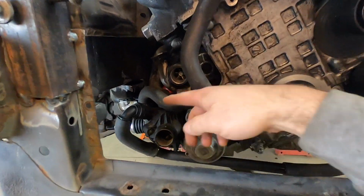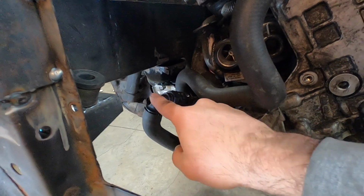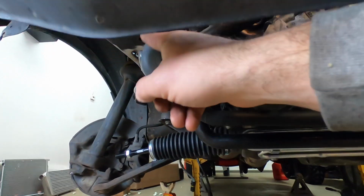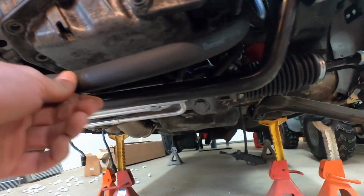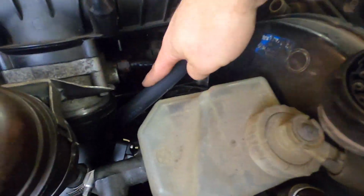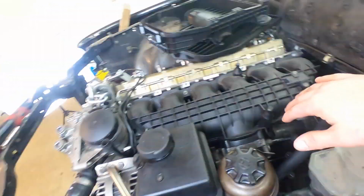Okay. The other end is this heater hose here, where I've conveniently modified this quick connect on the output of the thermostat and turned it upside down. So instead of it going up, like it normally does on the N54s, it is turned down. I put a hose down here, right? A couple of clamps here go to a plastic hose, which then goes to a 3/4 inch hose. This is all going to be held in place and clamped, but it's going to end up going straight up, where it will then be teed under here. There'll be a T here, a three-quarter, three-quarter, three-quarter T, and that'll go into the bottom part of this coolant reservoir, and this will go right to the bottom of the heater core. That's going to take care of that hose.